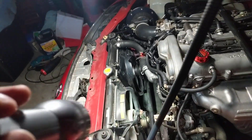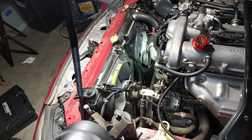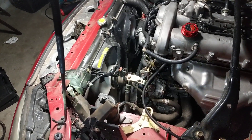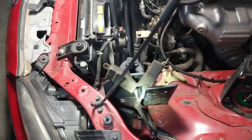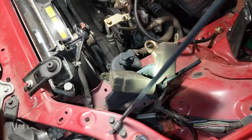The plan is to manually wire a switch in the cab to run both fans as an override. That way I don't have to have the AC pump running to engage my fans. There are two relays here in the front behind the driver's side headlight.